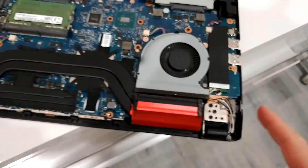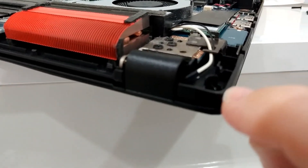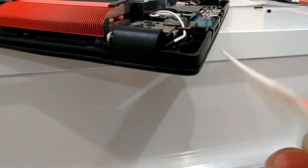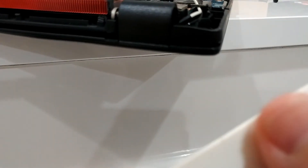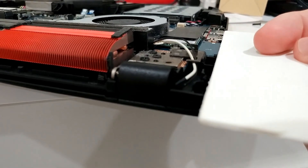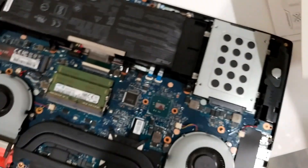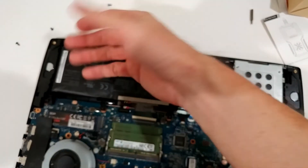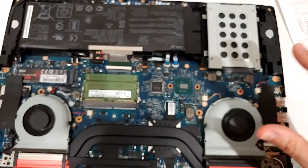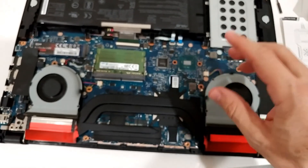After removing the screws, you have to open the backplate — there's just a really tiny gap. I used a plastic kitchen tool, something for dough — it's plastic so it can't cause much damage, and it's rather thin. I worked around the corners, grabbing the lid slightly. Just two corners to start, then once I could grab it with my fingernails, I worked along the sides and removed the backplate easily.